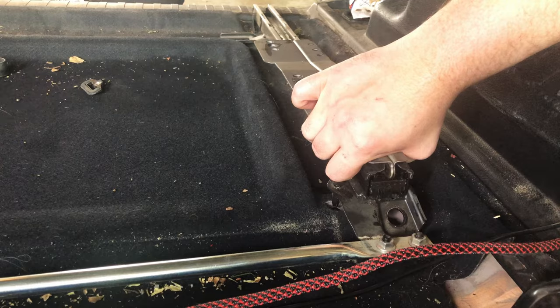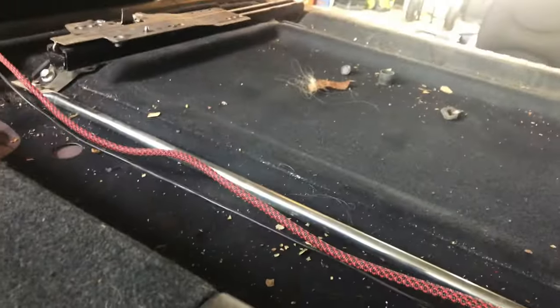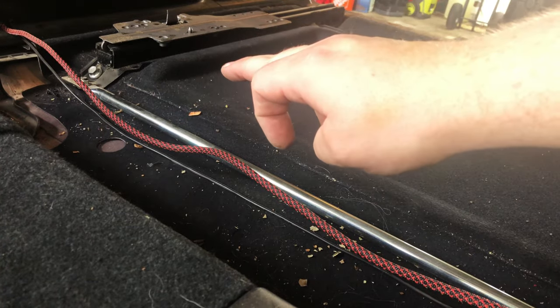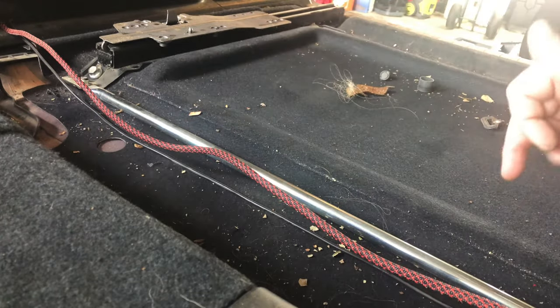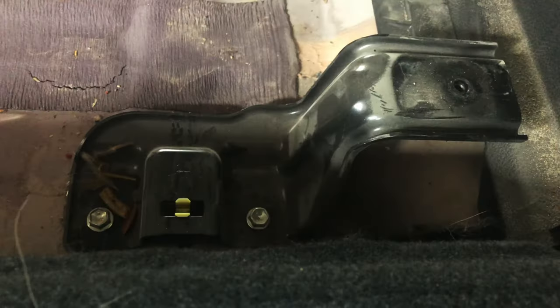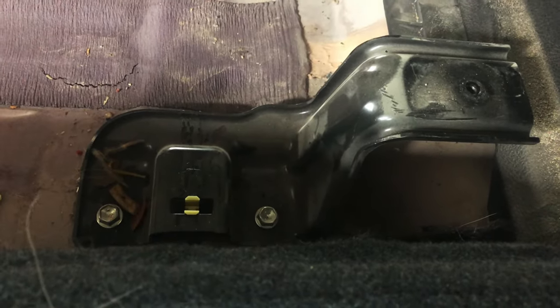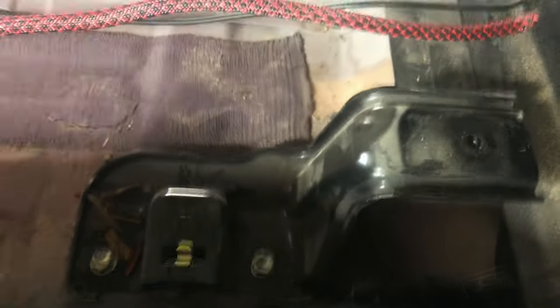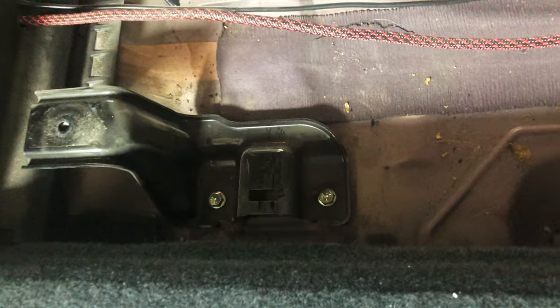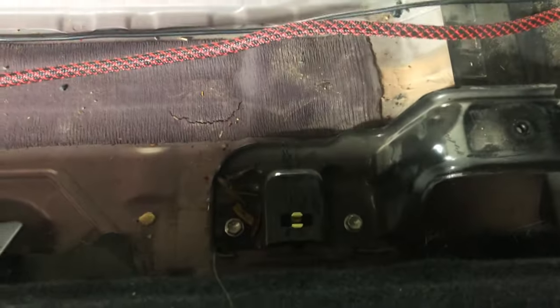You can see the silver piece here — it's a bar that goes the whole way across. There's a lot of dirt back here, but it goes the whole way across. You can either undo these or just leave it together and take it out once you undo that bolt — up to you. The final touches are to remove these brackets here: there's one here, one here, both held in by two 10 millimeter bolts. Once you remove those, everything should be complete.